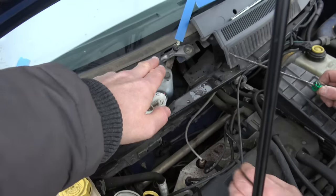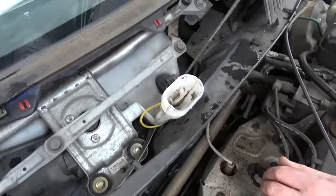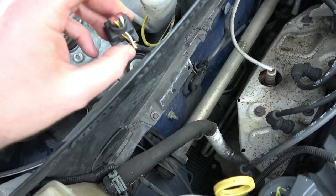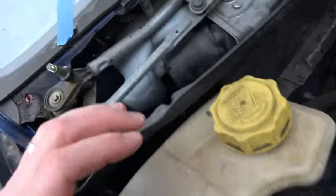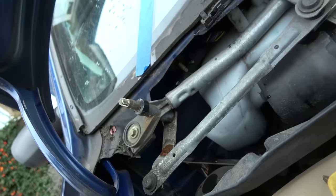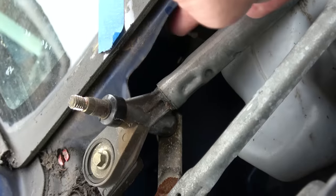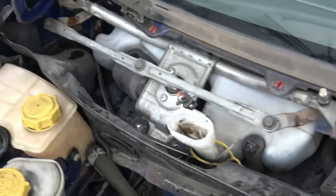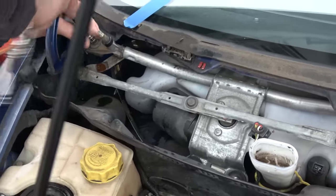We've put a little bit of tape on the windscreen lining up with these arms here, so we know the wiper motor assembly position when we take it out. We're just going to try to undo this connector here - it lifts up and away, then push the metal clip back in so we don't lose it. Now we're going to start undoing the bolts. This wiring loom here is attached to the motor and there should be a little nut just here but it's missing - it must have vibrated off or was never fitted from new.